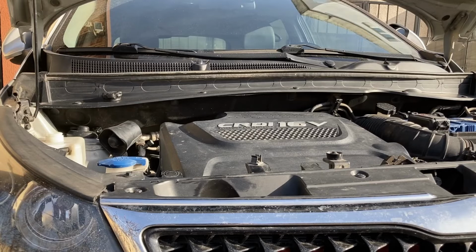I actually did struggle a little, simply because, as I mentioned earlier, you have to pour slowly, otherwise you add air into the system. Because I didn't really pour as slowly as I should have, even though I drained 2 liters, in the first fill I only got 1.6 liters of antifreeze, and then I had to squeeze the pipes, turn on the engine, and so on to be able to add the remaining amount. But anyway, that's done. The radiator cap is back on. And as a side note, I will be replacing the cap, even though nothing seems to be wrong with it, just because the car has 8 years and 150,000 kilometers.